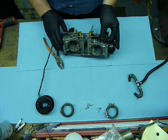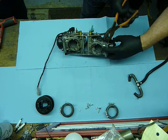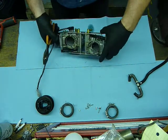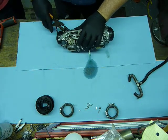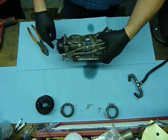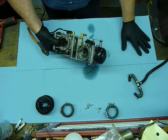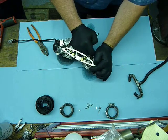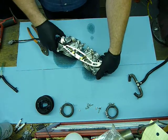These carburetors have been worked on a little bit in the past by somebody else. These are the bowl vents. I'm going to take these guys off and ultimately replace them with separate vent hoses — one for the front and one for the back. This is the front carburetor, and in the Adventure Machines kits that would be the 11-inch hose provided in the kit, then use the 10-inch hose in the back.